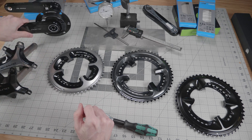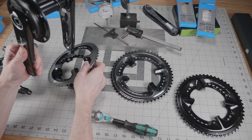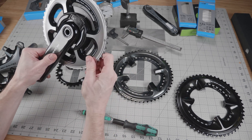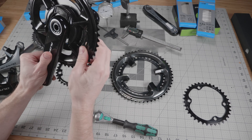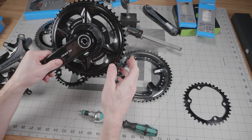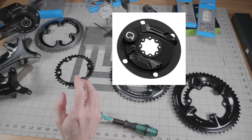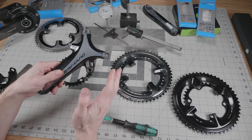Looking at third-party crankset compatibility, this is the PowerToMax 4S — meaning 4 holes instead of 5 BCD. Since it has exactly the same 4-hole spacing across generations, all three chainrings will work on this third-party crankset just fine. The same is true for other third-party power meter spiders that use a plain circle with 4 bolt holes. However, this is not true for the COBB 4-bolt power meters, which use the same sculpturing as Shimano — so they'll have the same sculpturing compatibility and cosmetic match issues as the actual Shimano cranksets.